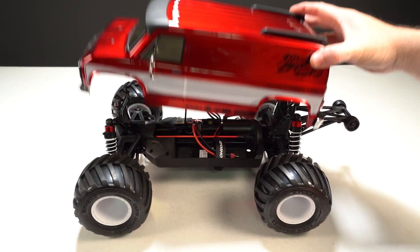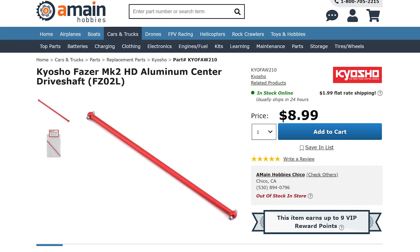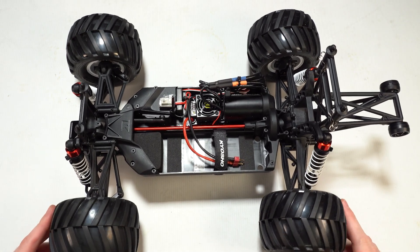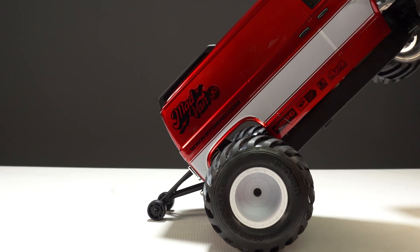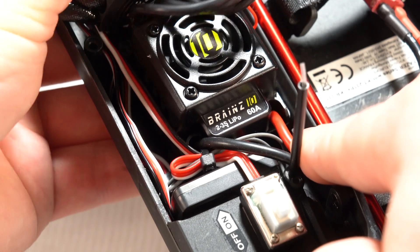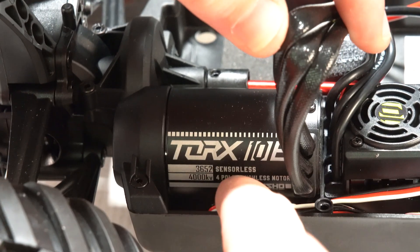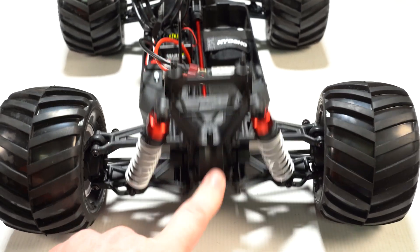To help the Madvan cope with these upgraded brushless electronics, Kyosho has added some upgraded items into the VE, including an aluminum center drive shaft, which is just an option part for the other vehicles. This drive shaft will stay straight and true during really high RPM spins and is an excellent upgrade over the previously used plastic drive shaft. The VE also includes an updated gearbox with high-strength metal gears and an updated final drive ratio to better suit faster brushless electronics. The truck also now has a wheelie bar that's extremely well-braced and stiff with almost no flex. The brushless electronics themselves include the Brain Z 60-amp ESC, which is compatible with 2S and 3S LiPos and features a T-style battery connector, paired with a Torx 10E 3652 brushless motor with 4,000 kV. Note that this motor is only 2-cell LiPo-compatible.